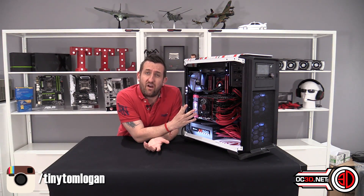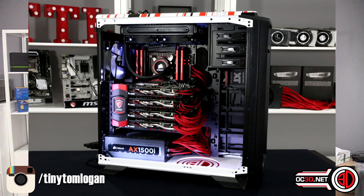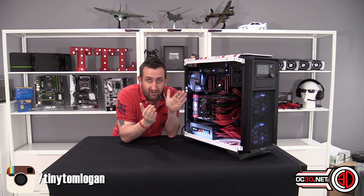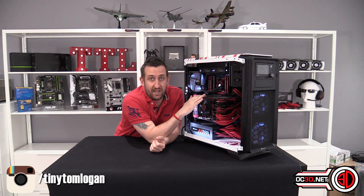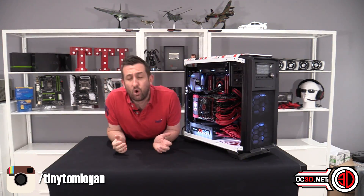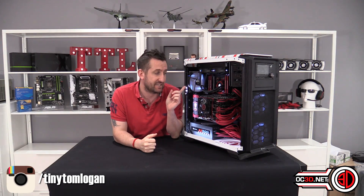With the fan on the side, I would actually go as far as to say that it spoils the look — I think without it you just get to see the card and it's a much cleaner look anyway. This is because it's a quad SLI setup; if you had a single card and you were directing air directly over a graphics card, then you may pick up some temperature benefit. Where they are all sandwiched together, essentially the two middle ones are the hottest — the bottom one doesn't do too badly, the top comes in second, but the two middle ones you're looking at 85 to 90 degrees pretty much as soon as you hit anything 3D. Performance-wise, Firestrike Ultimate was 10,717 and Firestrike Extreme was 18,145 — that's with the 5960X and four 980s.